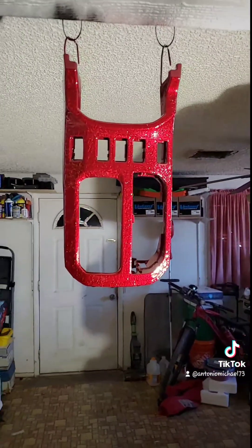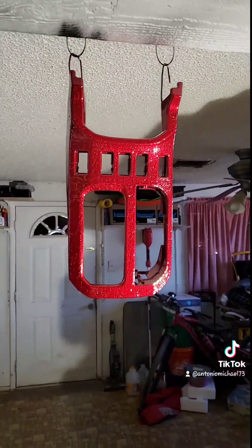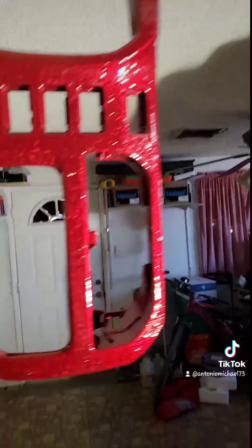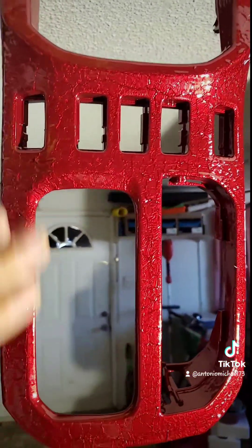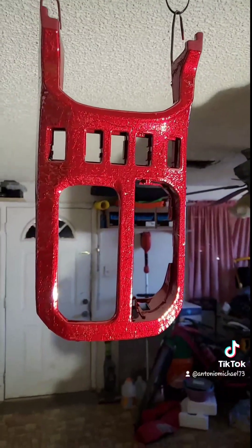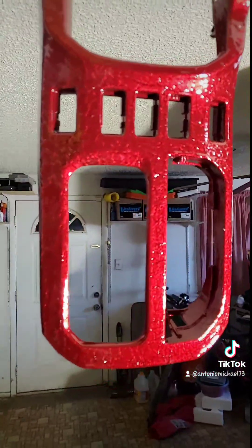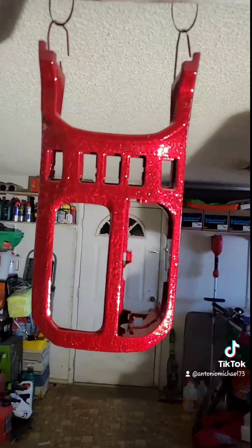And then I put dark cherry metallic from Dupli-Color on here. It got two light coats, then one semi-heavy coat, and then four light coats of clear coat. It actually looks pretty good. I like the wrinkling effect — I call it a hammered effect. I've duplicated this effect hundreds of times. That's just from putting the paint on wet a little bit too close, or a little bit too wet. What happens is if you spray another immediate layer on top of it, the very first coat that was trying to off-gas is actually off-gassing into the coat that you just put on, which causes the secondary coat to start cracking and wrinkling. It does that because one layer is trying to off-gas into another liquid layer — that's how that happens.